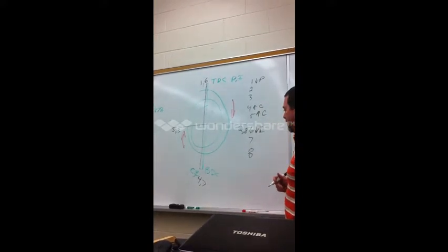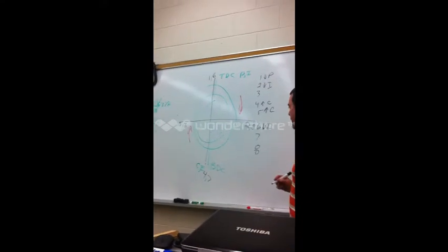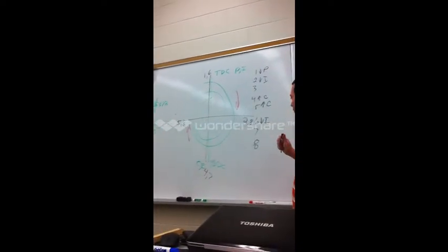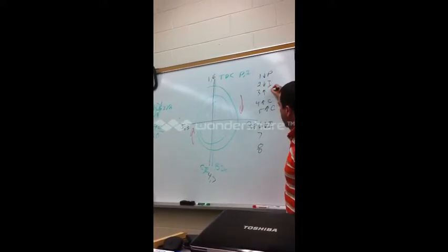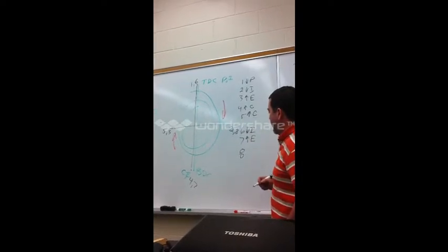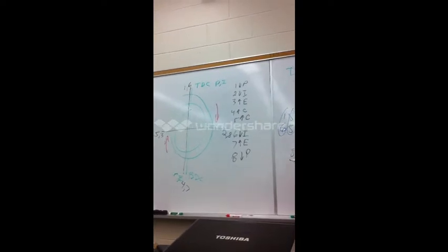What comes next? Two. Up or down? Down on intake. Next? Six. Up or down? Down, on intake. We've already got it. How do we get that? Mating cylinders. Okay, next? Three. Up or down? Up. On? Exhaust. Next? Seven. Up or down? Up, on exhaust as well. And lastly? Eight. Where's it going? Down, on power. Everybody okay with that?